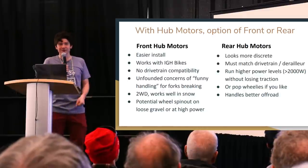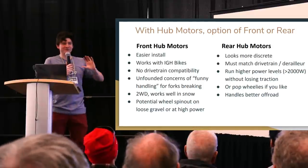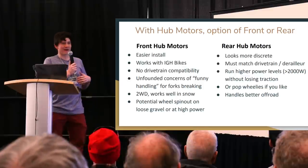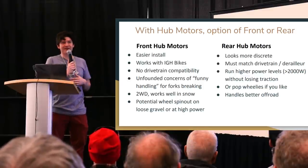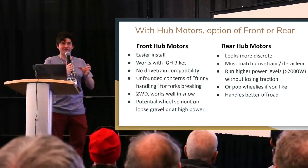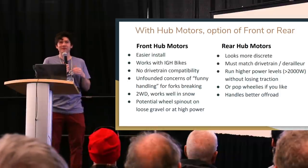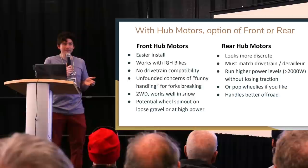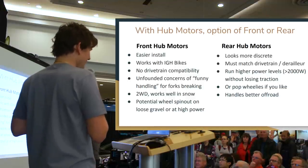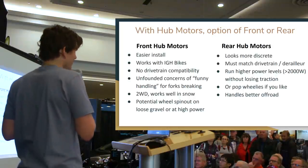The cases where that breaks down are mountain biking where you lift the wheel off the ground, or if you're putting so much torque in the motor that it risks spinning out. With motor powers up to 500 or even 1000 watts, a front motor has more than enough traction to go full throttle without the wheel skidding. But if you're running 1500 watts, or riding on loose gravel roads, a front motor will skid out quite easily, so you'd need to shift your weight over the wheel.